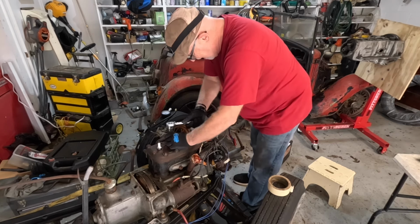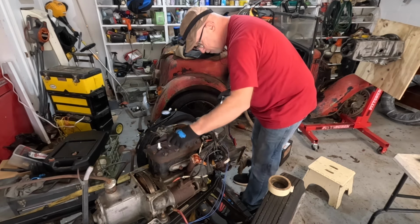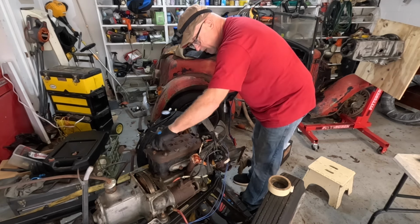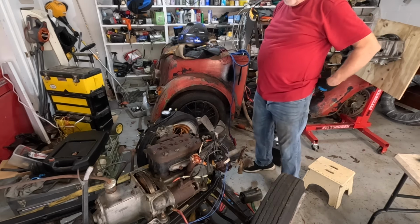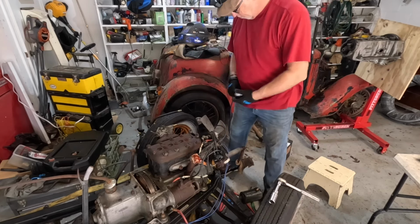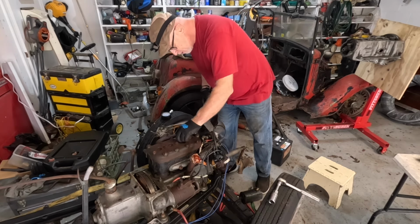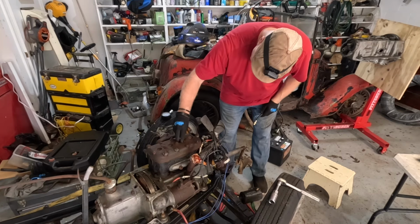And remember, it said to add some oil in there if you need to increase the compression, right? So let's do that as well. And I don't know, what's a normal compression setting for an Austin 7? So that first one, there was 25, I know. I think it says 120 for the Morris Minor. Maybe 100 would be a reasonable expectation here. So what does that mean? It means all the valves are stuck open, or, you know, zero compression because the rings didn't come around. Anyway, we'll see what each cylinder says.